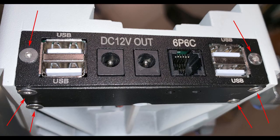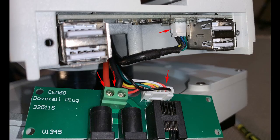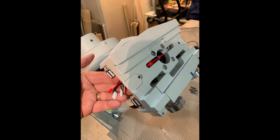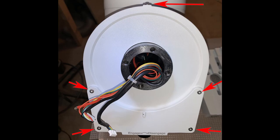For the next step, you'll want to rotate the mount head 90 degrees so you can get the screwdriver up under. First, remove those two little tiny screws facing you, remove that black plate, remove the four screws below, remove that black plate, and then that circuit board will drop down. There are a couple of little connectors and a couple of tiny Phillips head screws for the 12-volt power. The connectors wiggle off pretty easily — the toughest one is right up there behind the two USB ports, it's just hard to get your fingers in there, so a small tool would be optimal. Once those are free, the circuit board will come out. You can feed those wires back up through the declination plate and pull the declination plate right off. That exposes the last part — the cover. Remove the four screws facing you and then one tiny one on top — those are very easy — and then that cover plate just comes off, and you're done.